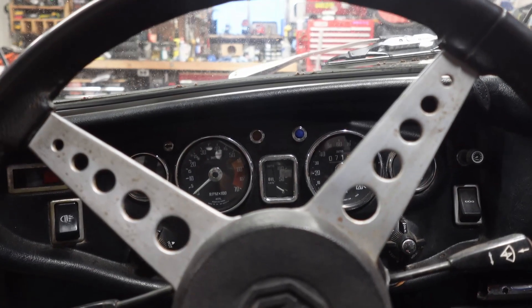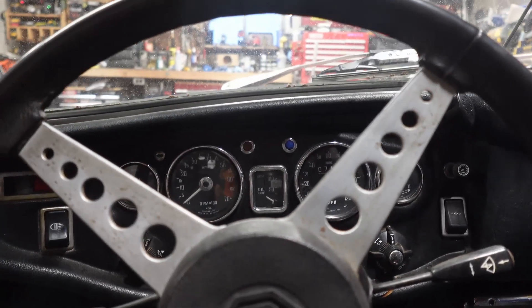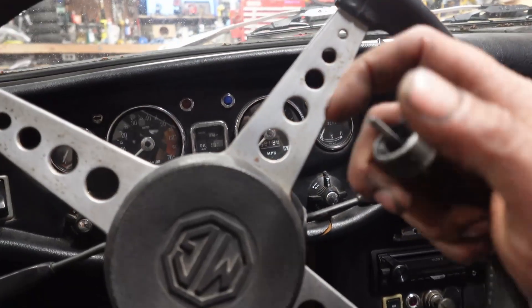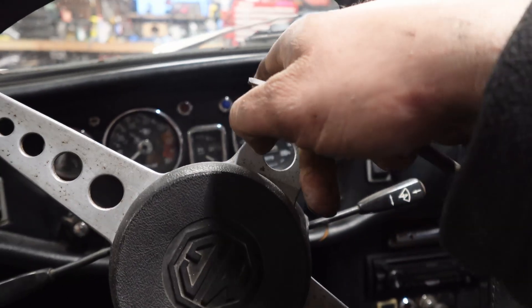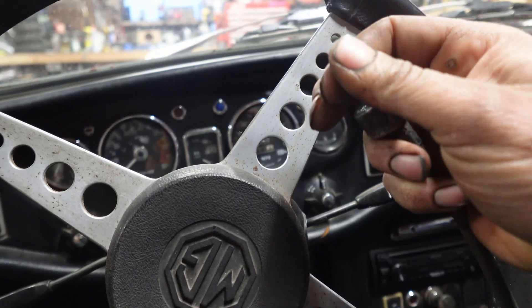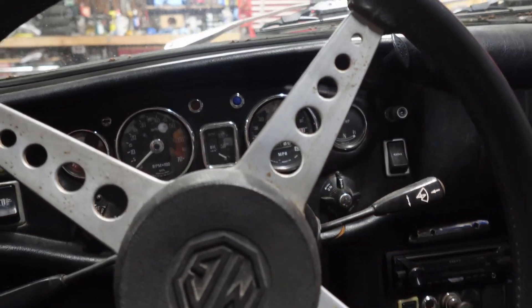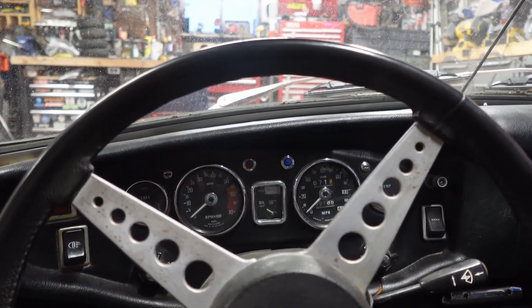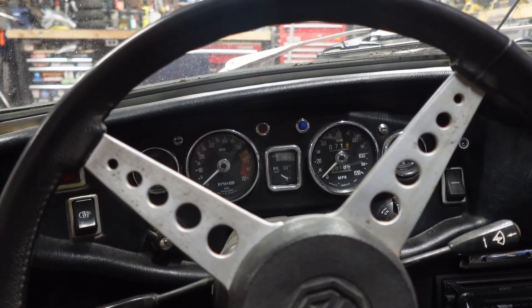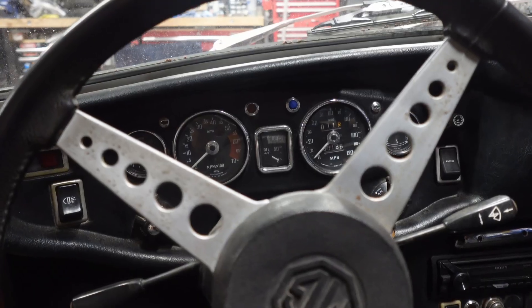I can't tell which it is until I lift the rear wheels off the ground and try to spin it. But I did another piece of diagnostic: I have a spare cable installed into the back side of that gauge, and I cannot turn it — I know for a fact I can turn this cable when it's not installed. So I'm thinking the problem lies with that gauge, or possibly that add-on angle drive going into the gauge.